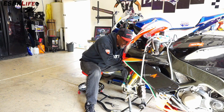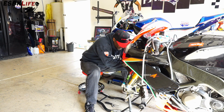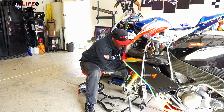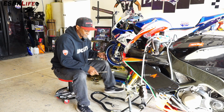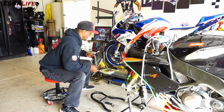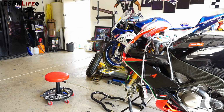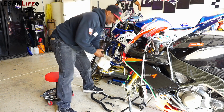And this is also a really good time to check your pads. I mean, if the wear is really, really bad, they're already off the bike, so this would be an ideal time to replace them if they need be. All right, those are nice and spread out. And we're going to clean this axle up, re-grease it really quick because it rolled on the floor. I got some debris on there. Great. Set that like that.